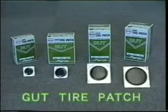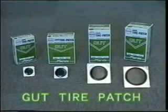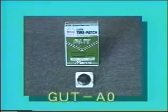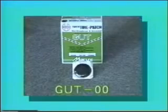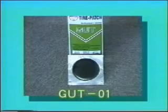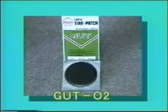Moderni's GUT patch series can repair almost every type of tire and many types of small damage easily and economically. Patches are available in 4 sizes according to the damage and type of tire: 34mm diameter GUT A0, 43mm diameter GUT 00, 65mm diameter GUT 01, and 78mm diameter GUT 02.